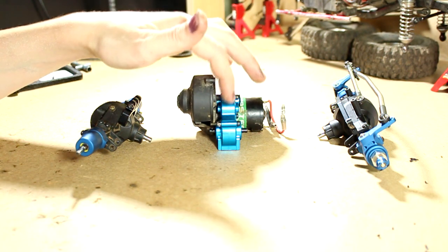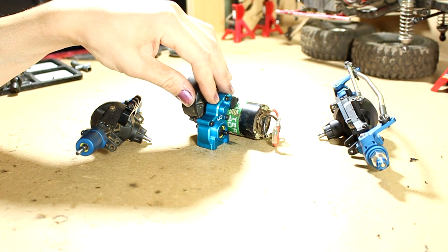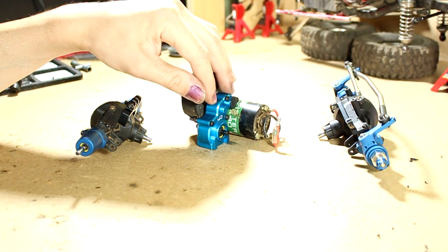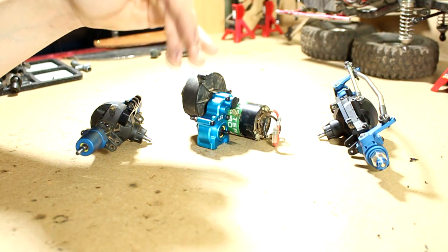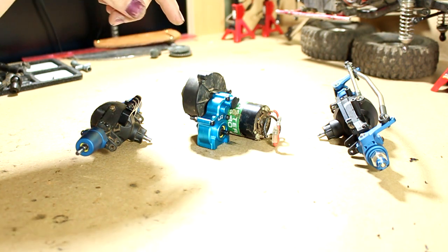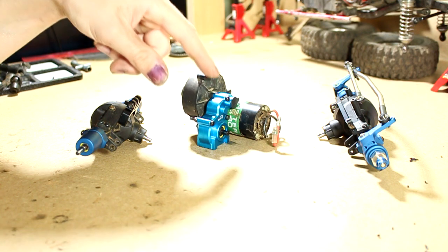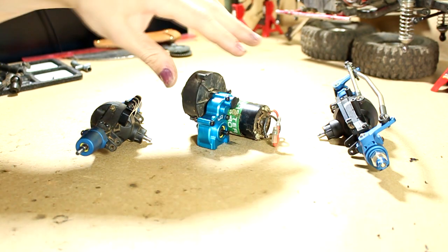So I have Incision steel gears inside this transmission, and the center idler gear actually came with larger bearings than is stock. So I actually had to keep the bearings that I had in there, which would be the ones that would have come with the gears, because the Incision gears did come with bearings. So I just left those in there because the size that is stock in there is a different size than I needed, and whatever, you get the idea. So that's it for the tranny.